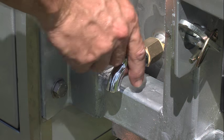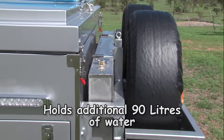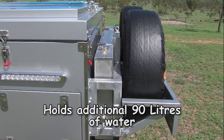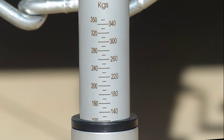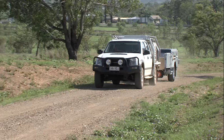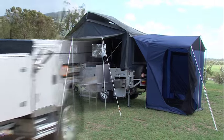Really, it's an extra water tank — but it is where it is positioned that makes the difference on the ball weight. Adding the weight of water to the back of the camper decreases the weight on the tow ball by up to approximately 30 kilos. Carry more weight but use less engine grunt to tow it. Brilliant!